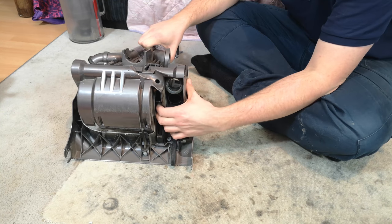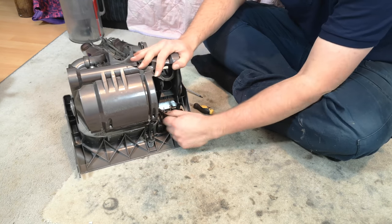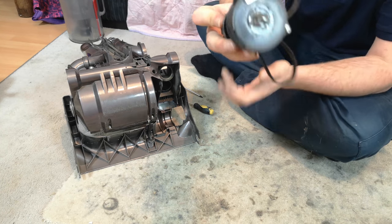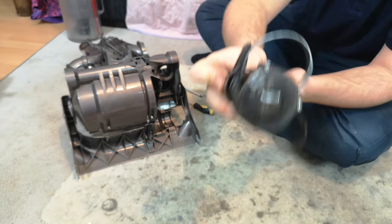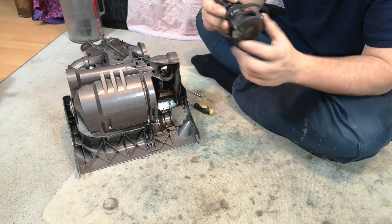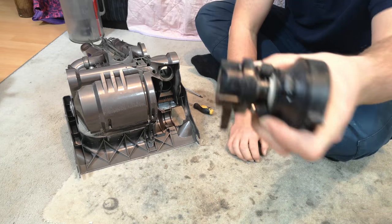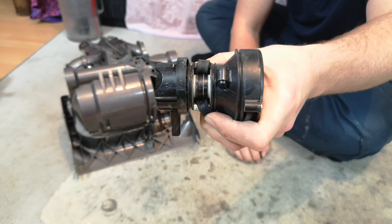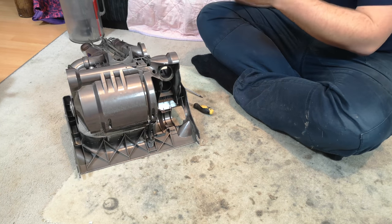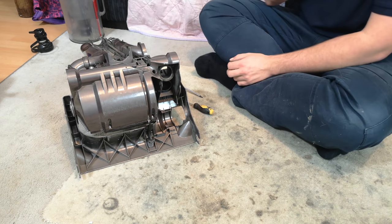Then take the clutch to motor belt off of the motor, then grab both belts and pull out. And here is our clutch, dated the 27th of March 2012, which should date the machine. They are genuine belts. No, they're not. They are pattern belts. So somebody has been here before, but we're going to change those. The white wheel is okay. These wheels wear. This one's wearing, but fresh belts will sort that. I shall do that off camera because I already have a clutch rebuild guide, so we don't need to go through that now.